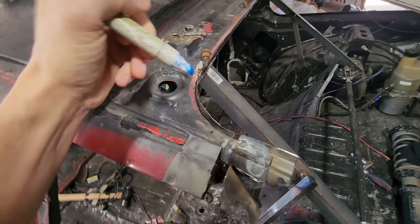The inner structure is now fully welded onto the car. I added a couple more tack welds between each of the original spot welds just to stiffen it up more than factory — it is so solid. I thought it would flex a lot more, honestly. My next step is spraying weld-through primer on it. Now that it's fully welded on, we can lower the jack that's been holding up the rear end to see if it stays level — and it did. That shows how important this inner structure is to the car. We can also take off the roof jig now since the car is being supported in the correct dimensions — straight chassis. The window triangle looks so good.